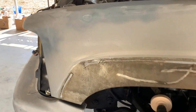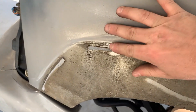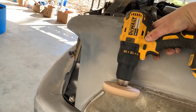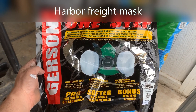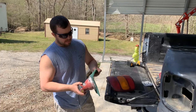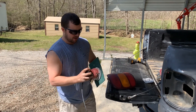For removing badges or any adhesive that's left, you can sit here and do this for a few days, or you can get one of these — it's basically a giant rubber eraser. You just erase it right off. Some people cut these round but they work just fine even if they're square like this.